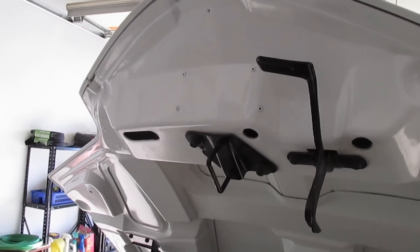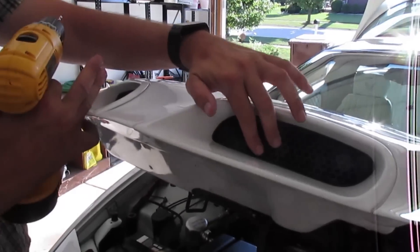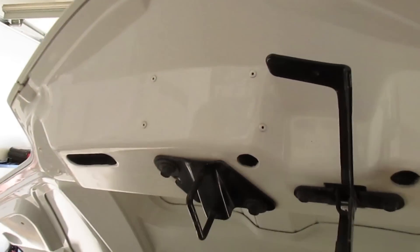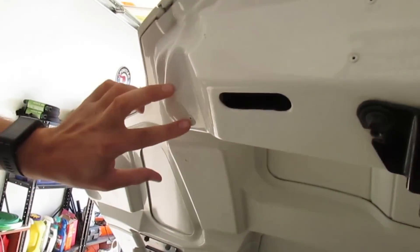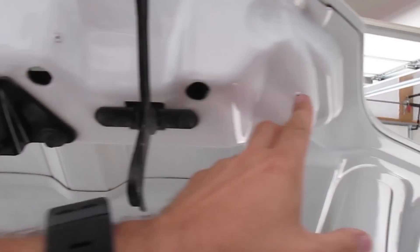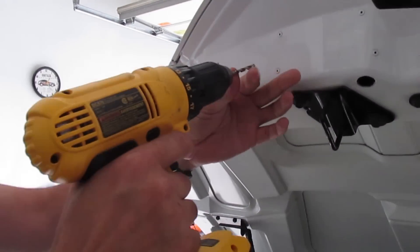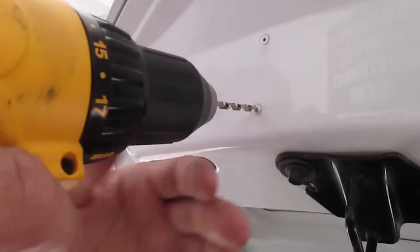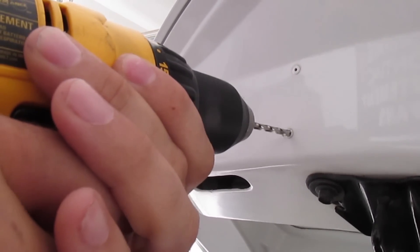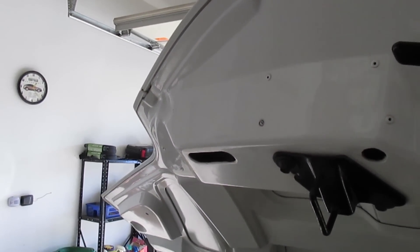Here's the first step to install a Knight Rider light. First, you need to remove the front baffles inside behind the grill. To do that, you have to drill out the eight rivets — two here, two here, two on the bottom over here, and two on the other side. To drill out a rivet, all you need is a drill bit just a little bigger than the hole. Use light power — you don't have to go crazy. You'll see the head spin, and you're done. Then move on to the next one.